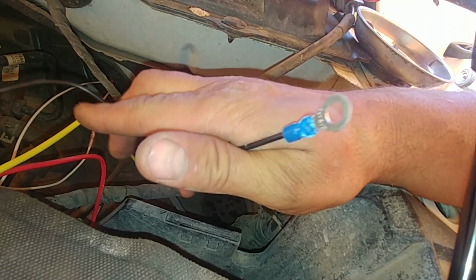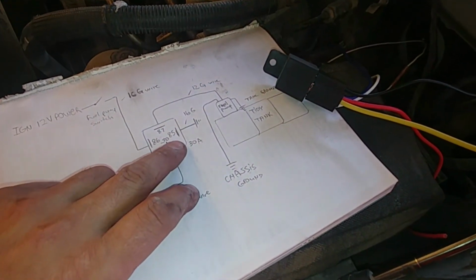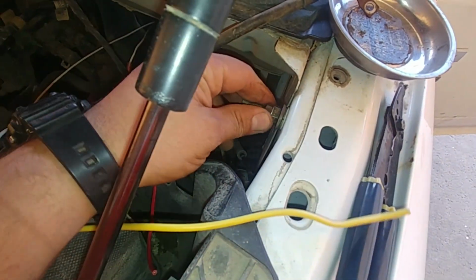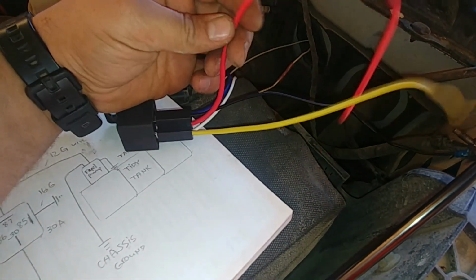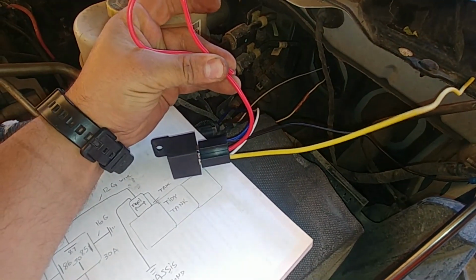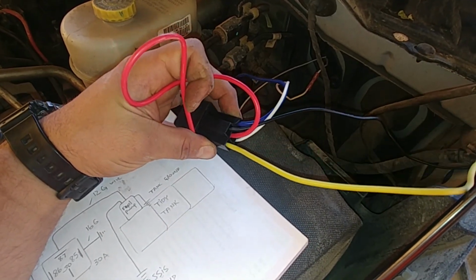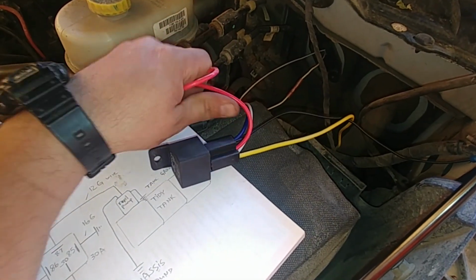so I already crimped another end, which is a relay, and put it all back together. 85 relay ground is connected, all clean and tight, as you can see. And don't worry about the 87A, we're not using this, just do it like this and wrap the electrical tape at the end. I don't like cutting those ends, you might be using, or just let it be wrapped with electrical tape.